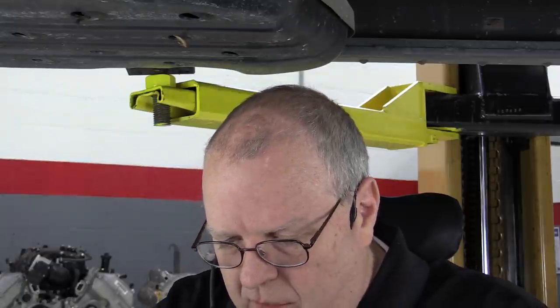So that covers the tubing, slip yoke, slip spline, and slip-in-tube — a quick visual inspection to perform. The next thing to look at are the flanges themselves. On this truck there are several types, but two types of flanges are commonly used. Let's take a look at both.